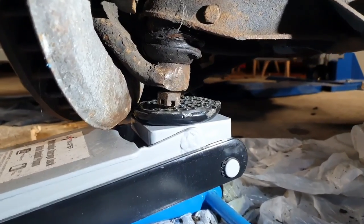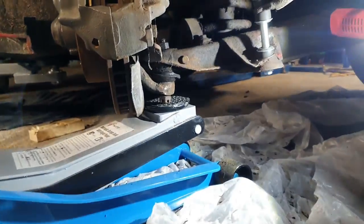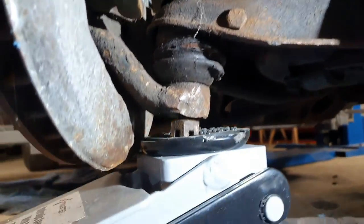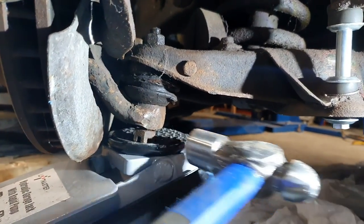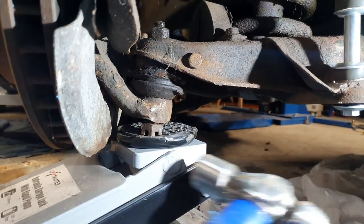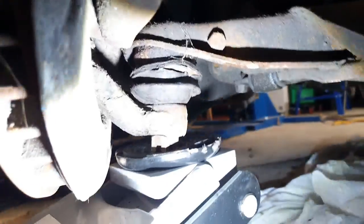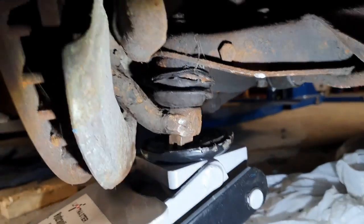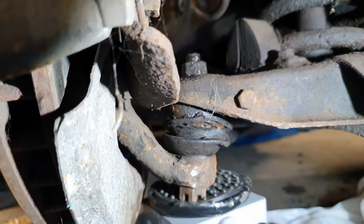After hitting it, it didn't completely release it, so what I have to do now is remove completely the pressure off of it using the jack. I'm going to jack it up there. The pressure is off the spring now - you can see there's a little gap still left there. I have to hit it with the hammer there and that should release it now. There you go, that went down - you can see there's no gap now so that released it. I'm happy with that, at least I know it will come out now.